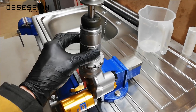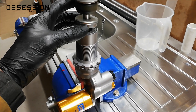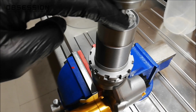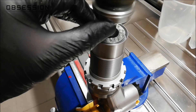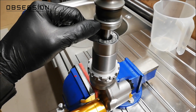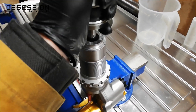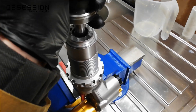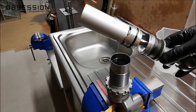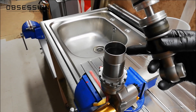Now that the gas pressure is released, the oil is no longer pressurised, so I'm going to take the piston assembly out of the other end of the shock. We've got a bump stop, then an end cap that keeps the weather out, then this plate here which screws into the shock body and holds all the seal head in place. With the seal head unscrewed, I can gently give that a wiggle and pop out the piston assembly. Now I have the piston assembly with the inner tube attached to it — and this is the outer tube, hence the term twin tube: tube one, tube two.